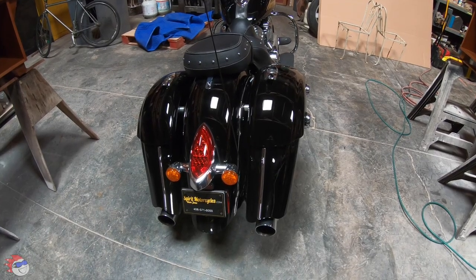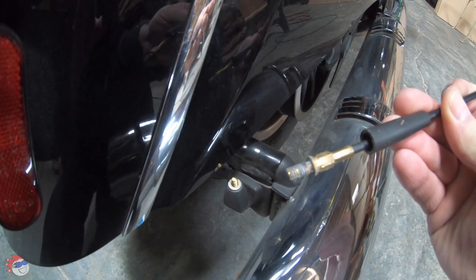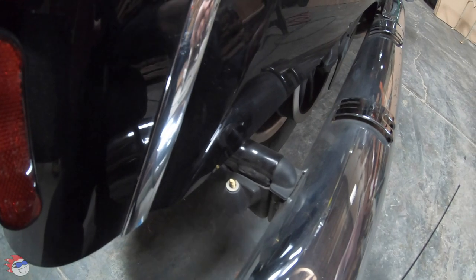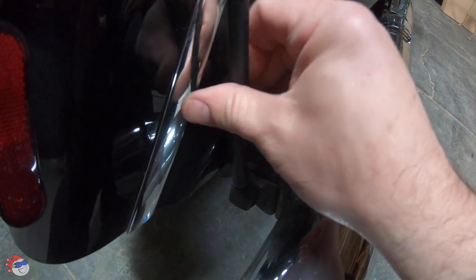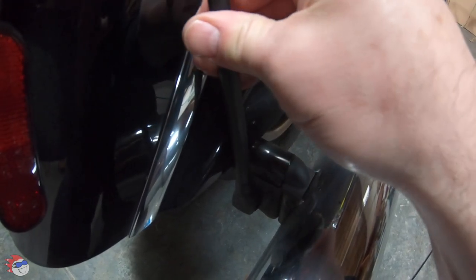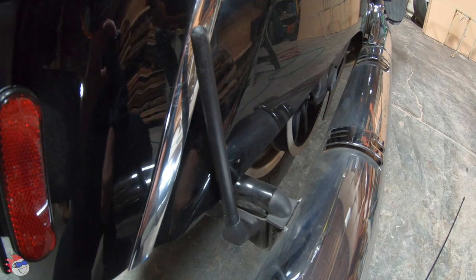The first thing you're going to do is pull the bags off the bike. You just lift this cover off and you can see the nut or bolt. I unscrew the stock antenna and take it off — I had something on there so the stud stayed in. The new one just screws right on, and I did put the washer down there. Get that on there nice, and that's it — little antenna. Don't have to worry about kicking it all the time.